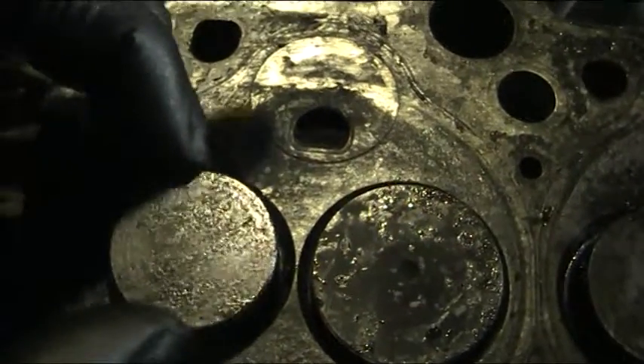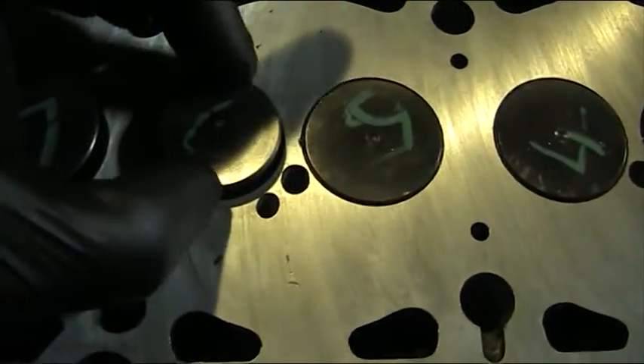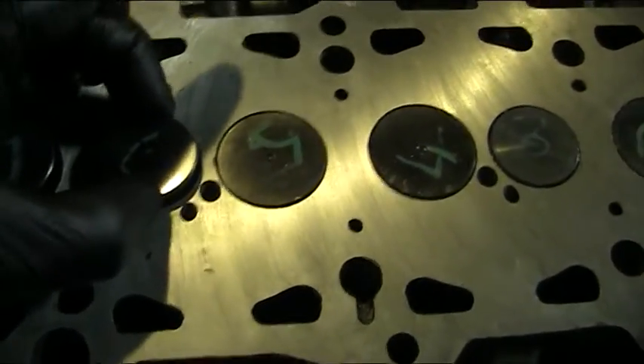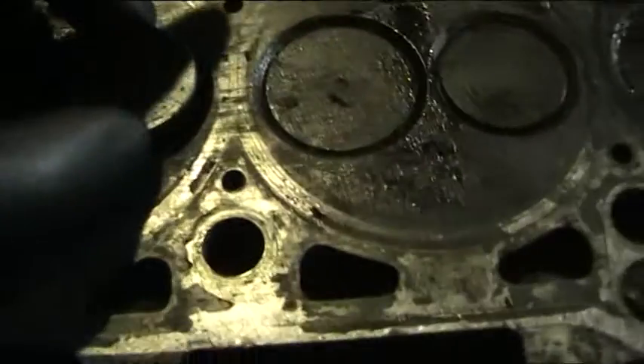You can hear that one clicking — basically not closing correctly. And then when we put the valve guides in, they turn out like this: virtually no movement at all, just what we call running clearance. And that's where your horsepower's lost — right here, obviously with your cylinders, your piston rings, compression rings, your bores going out of shape.